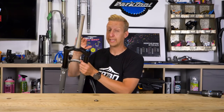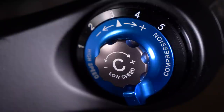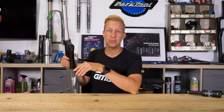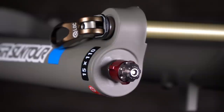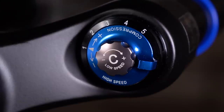The rider's right leg in this case has the damper unit in it — though it might be on the rider's left depending on the model of fork. Generally you'll have a compression dial or switch, which will be blue, and a rebound dial, which will be red. Rebound on most forks tends to be at the bottom of the leg and compression tends to be at the top.